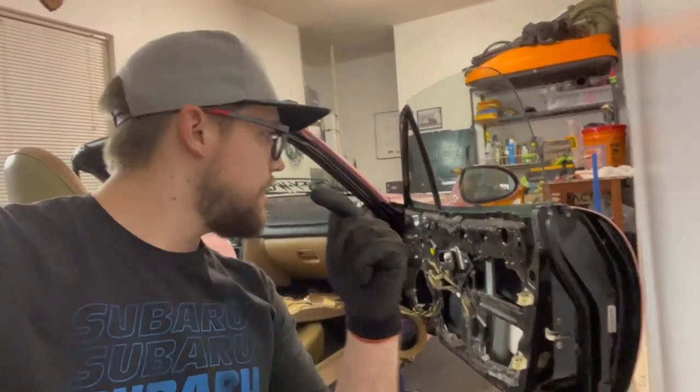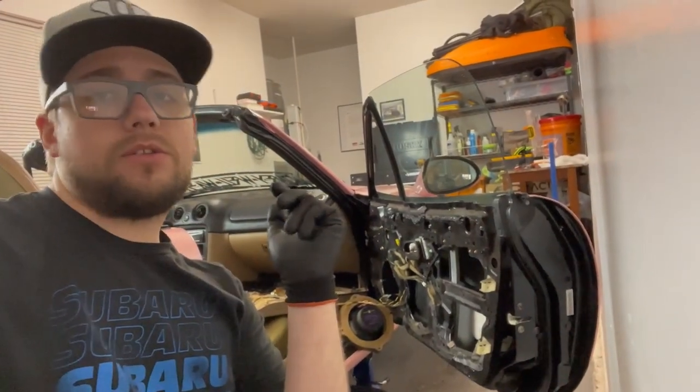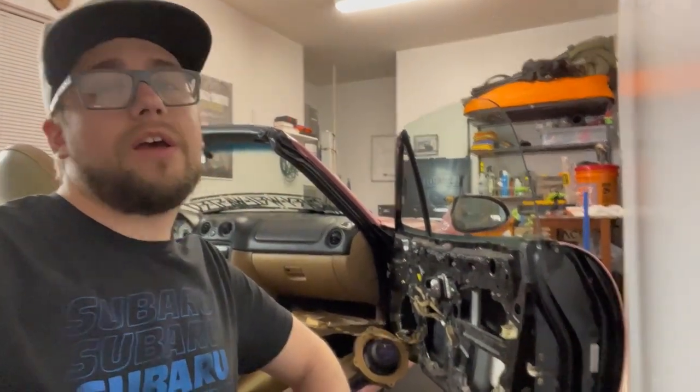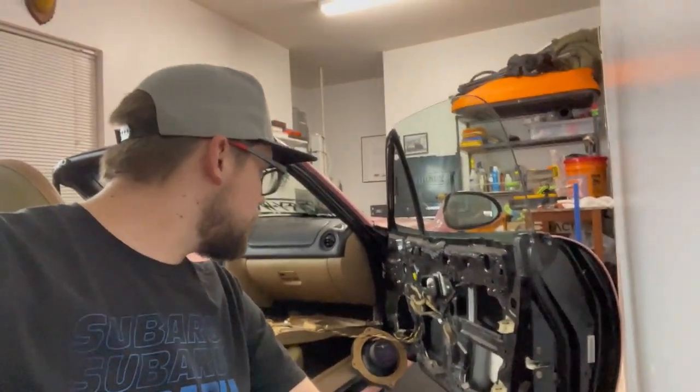The only real thing left to narrow this down is: either there's no power coming out of the back of the radio, which is the first place I've got to check, or those wires got cut or shorted out somewhere between the radio and the door. Apparently inside the hinge is a trouble area, so they might have just over time from opening and closing gotten pinched off or cut and are no longer making contact. We're going to check that.